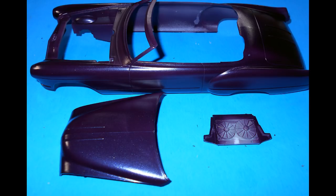Get your body pieces ready. In certain lighting this car's blue — a dark blue — but it kind of gives a purplish sheen, and I thought that would look great on this car. So I used the radar blue color from the '98 Indy Pace car; it's a purplish, bluish hue that really stands out on this custom Cadillac. I would use some light tack coats first, then follow up with successively deeper and a couple of wet coats, for a good glossy finish.